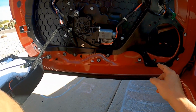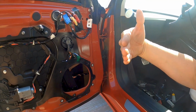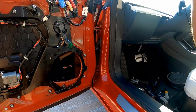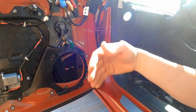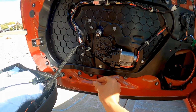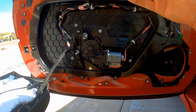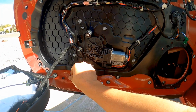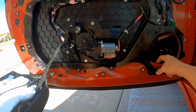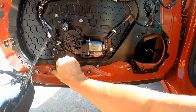So what I'm wondering is if as I loosened the front and tilted both the front in, it kept the gap the same front to back. So what I'm actually gonna do is, on mine, I'm gonna tighten the rear adjuster, which should push the back out just a hair. But if you're doing this for the first time, you'd probably wanna loosen the Allen stud, which would push the window in at the top.